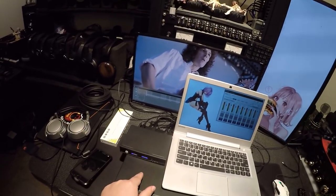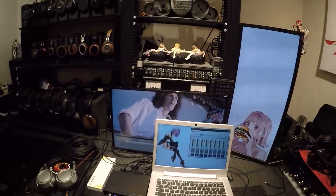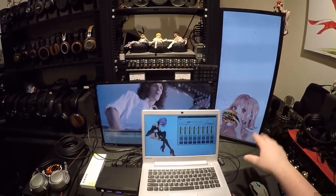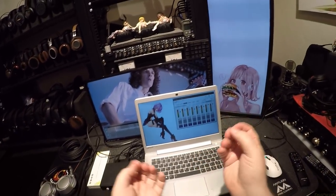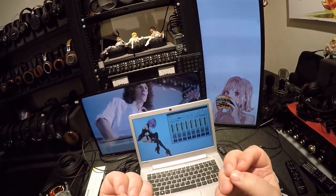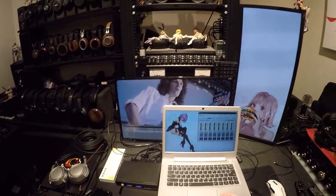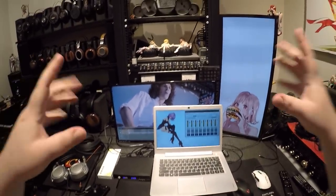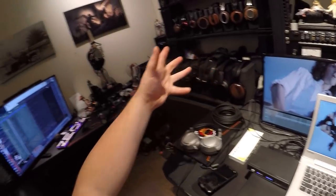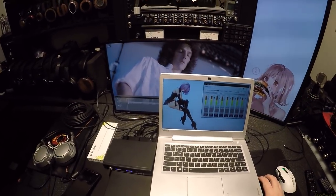I could have a config for late-night movie watching where every channel has the EQ set to just remove the low end, shut off the sub, raise the center channel so I can hear vocals — very basic. You can home-build whatever surround sound mode you like. You could do a crazy concert mode like I was doing, where I copied the left and right channel to the side channels, then copied those again to the rear channels, so that when sound happens it sweeps past you front to back.